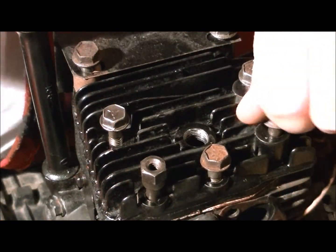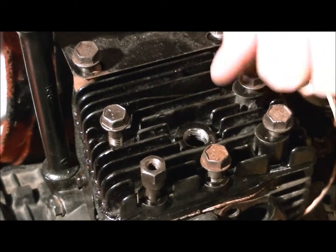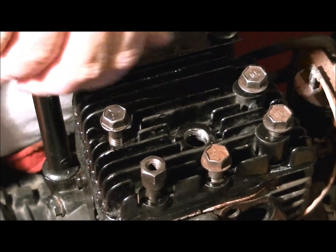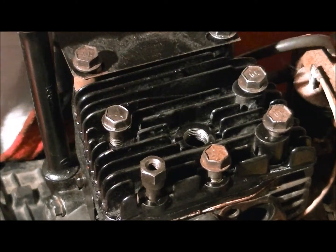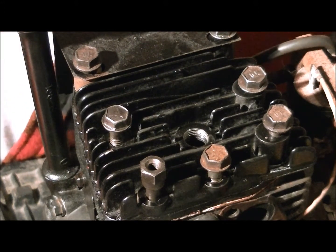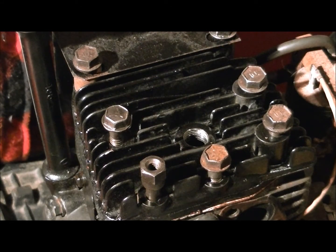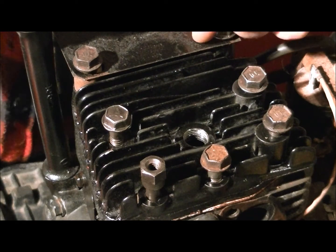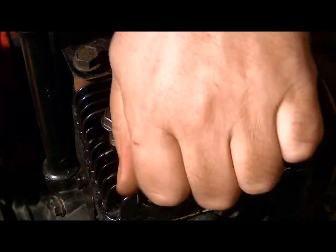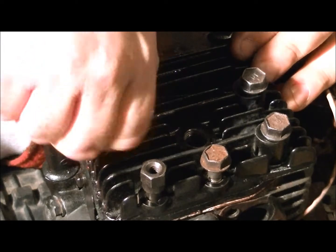You've got five long bolts, a short one, a short one, and the exhaust hanger. I'm not gonna torque this up or anything. This one was tough to get out - all corroded all the way down. I was probably 20 minutes getting that one bolt out. I'd run it down then run it back, run it down then run it back, kept hitting it with penetrating oil, and finally at about 20 minutes it came out. So you'd want to chase that hole with a tap afterwards to make sure it's good and clean.